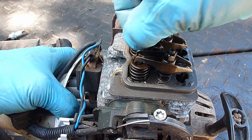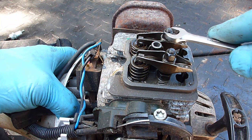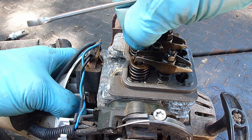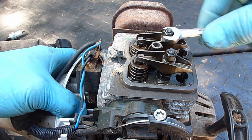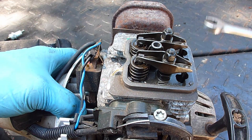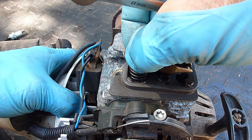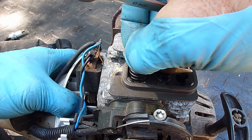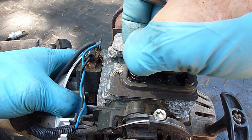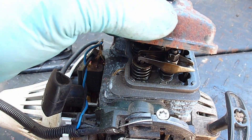Zero valve adjustment — that's probably why it quit running. Let's loosen these up. Ten thou is spec on these. I like to run my exhausts a little bit wider than that because I like a cool exhaust valve. The longer they stay against the cylinder head the more they transfer their heat. We'll go a little more on the intake. That feels great. We'll put the valve cover back on.